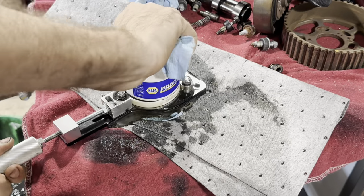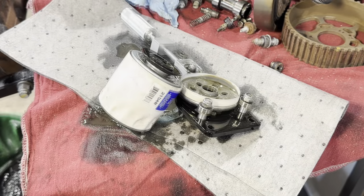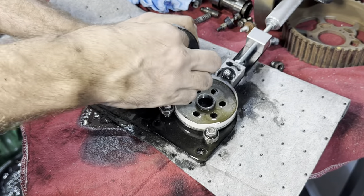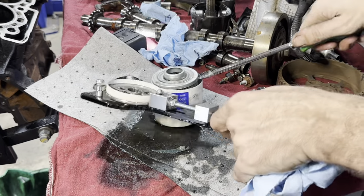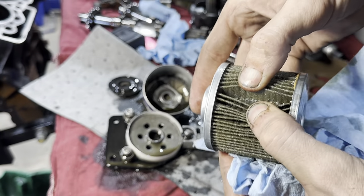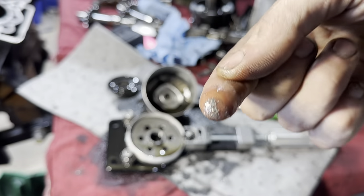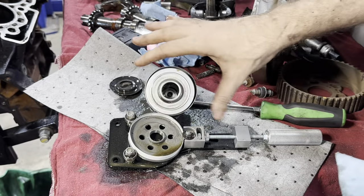And there's metal dumping out — a whole bunch of it. Yeah, this thing's loaded full of nasty. Here, I'll throw some more light on the subject. Yeah, look at that — that's all metal pieces right in here. Let's pull this filter out — I may need to pry it out of there. Let's try a pry driver here for the win. There it goes. Can you guys see? Look in there — oh yeah, it's full of metal inside of that filter. I think that's all bearing material. There's a bunch of glitter — see that right there? All bearing material, I think. She's done.